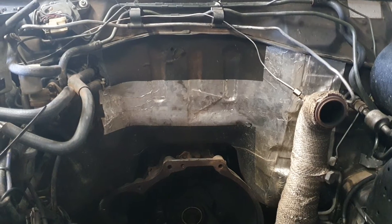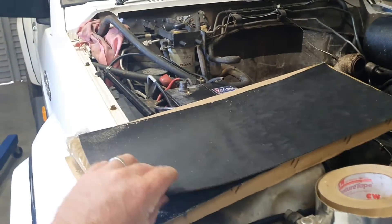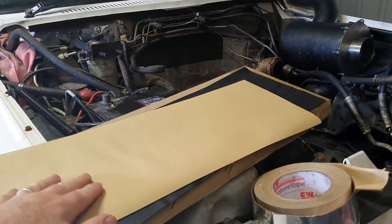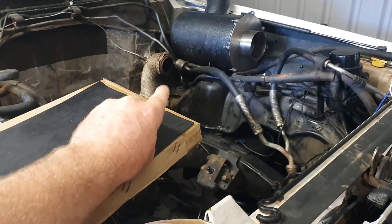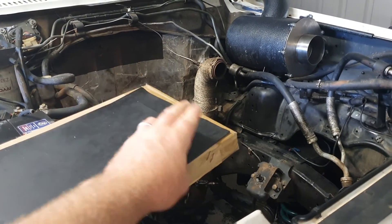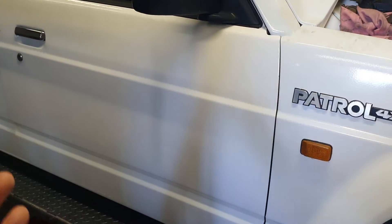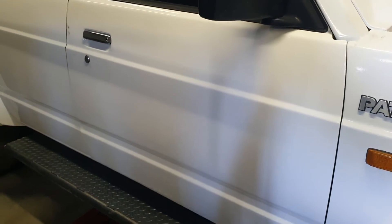A tip: when you're feeding this stuff through really tight spaces — for example just in front of your gear sticks where the dash comes through — feed it in with the backing still on it. Don't take the backing off first. Feed it through the gaps, then get it peeling a little bit and peel the sheet off in place. Otherwise it just gets stuck on everything. Same when putting it into your door skins — reach up through the speaker holes, get them all positioned, then rip the backing off. It just works really well that way.